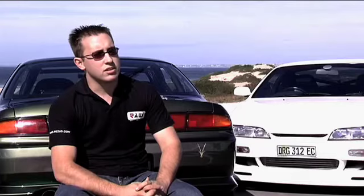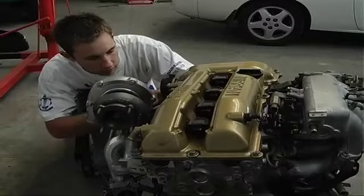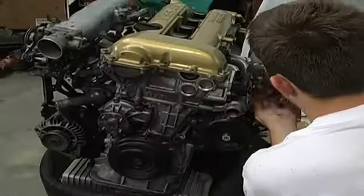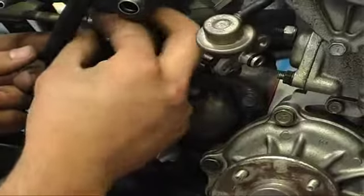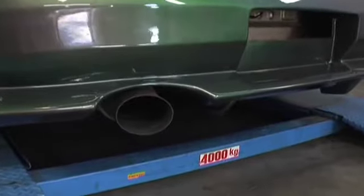What I'm going to be doing now is fitting water methanol injection to enable us to run more boost and more timing, to get it to spool up faster and run cooler in competition. We're going to modify the exhaust system to a better, freer flowing system, modify the differential to be a full two-way lock rather than 1.5 way, and set the suspension up to make the most out of drifting with the amount of power that it has.